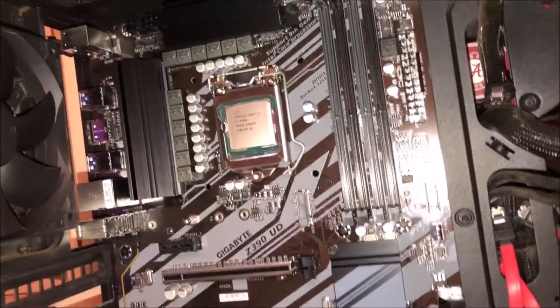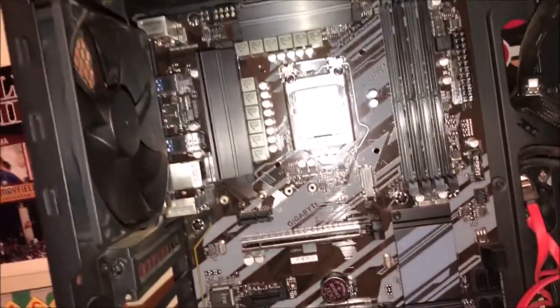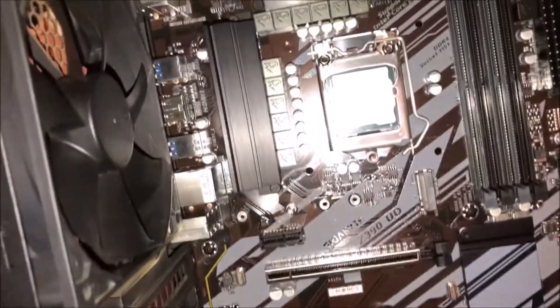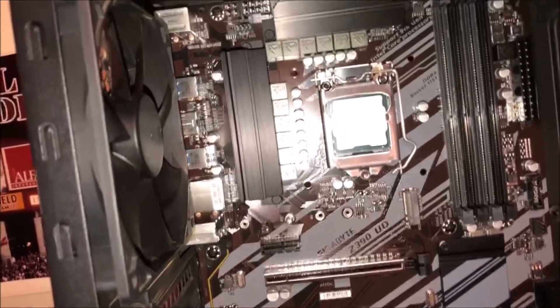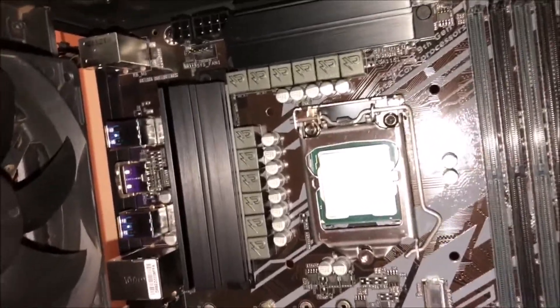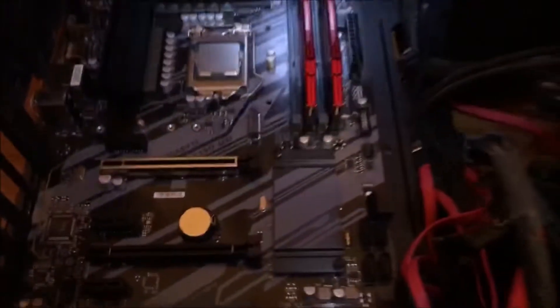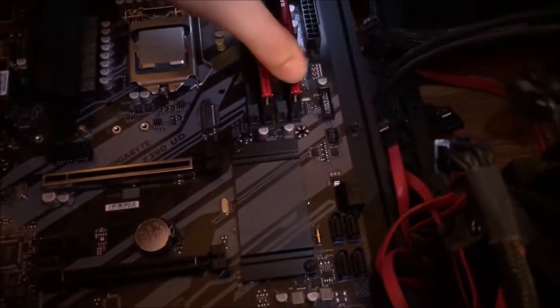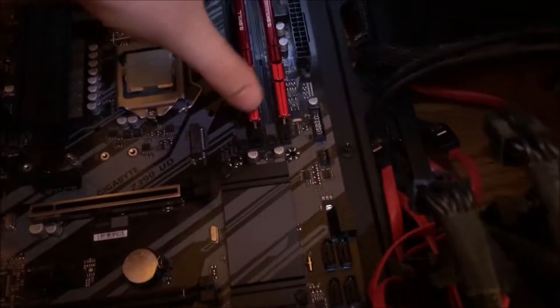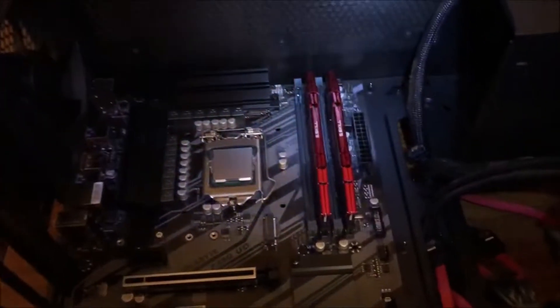Things are looking awesome. Got the motherboard flush in the case, all the standoffs are nice and tight and it's sealed in. Going to do a little cable management and start plugging things in, but before that it's probably a good idea to get the mounting bracket for the heat sink and get some thermal compound going. Putting back in the G.Skill Ripjaws brand new DDR4 — eight gigs times two. I got them nice and snug; you always want to wait for that initial click, so they're in there good.